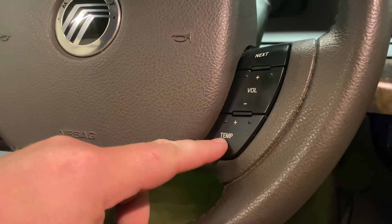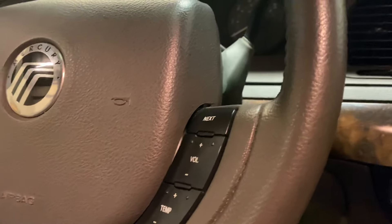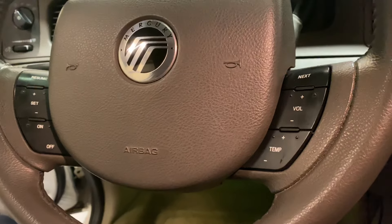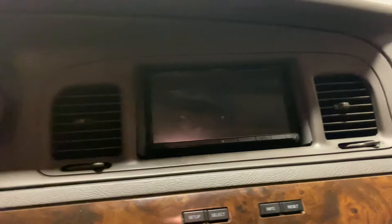Same with the steering wheel. If you have automatic temperature control like this car has, sometimes you'd get an optional wheel with controls for it. This car didn't have this wheel — it actually came out of an Ultimate Edition, one trim level higher. However, the wiring for these buttons — radio and temperature control — is already inside the steering column. All you gotta do is change the wheel and plug it in. The only difference is that if you've changed the radio like I have, the volume buttons will not work — you need a signal converter to make them work. But they do work; I did that because I wanted them to.